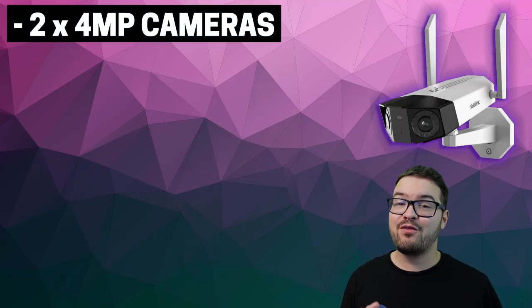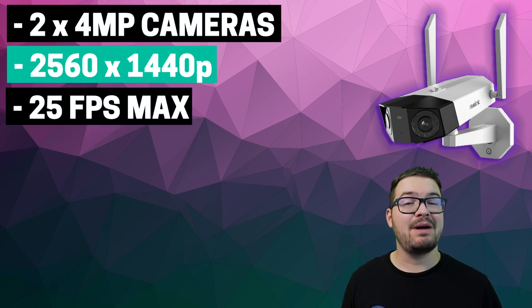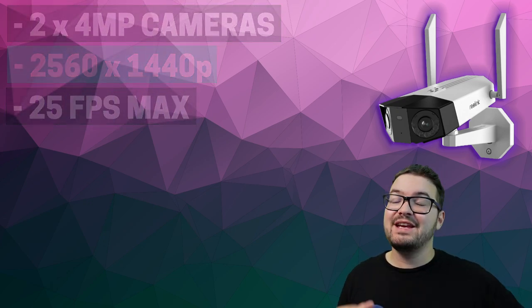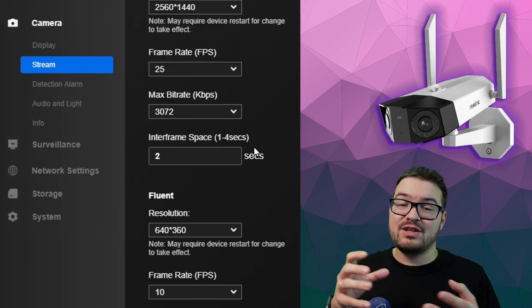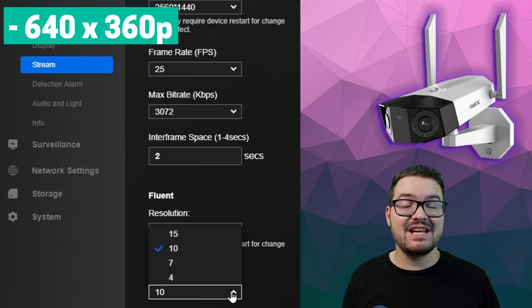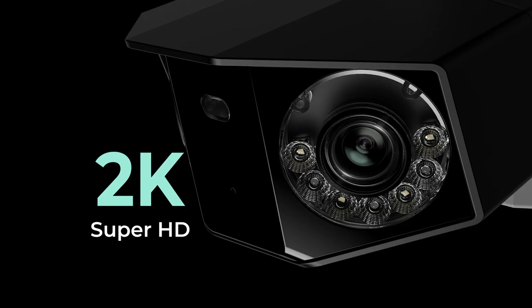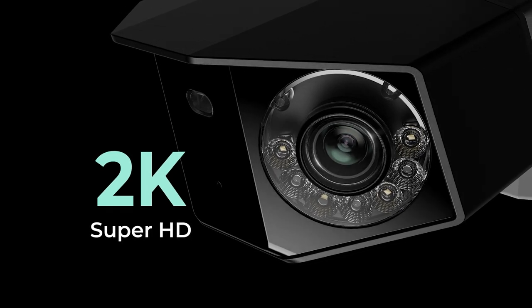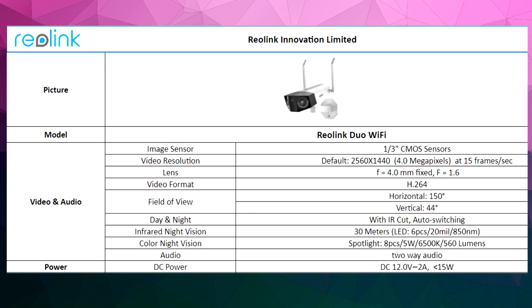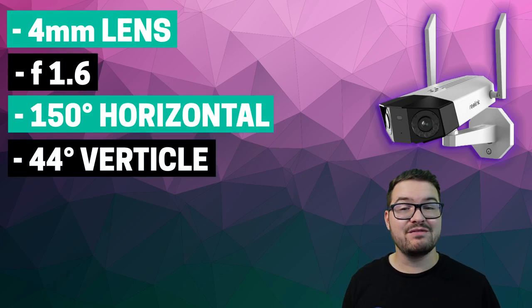The Duo features a 4 megapixel camera with a resolution of 2560 by 1440 and a maximum frame rate of 25 FPS. If for whatever reason you want to, you can also lower that resolution and frame rate, and you can lower it to a low of 640 by 360 and the low frame rate of 4 FPS. The 4 megapixel camera is Reolink's 2K camera that they refer to as the Super HD camera. It's got a 4mm lens and an f of 1.6, and when making use of both of those cameras, you get a wide viewing area of 150 degrees and a vertical viewing area of 44 degrees.